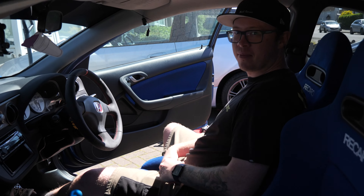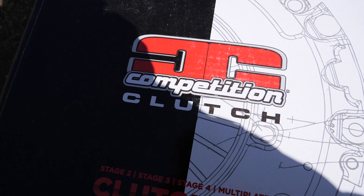Welcome back. So today this is Nurburgring prep — I'm scared of breaking down. What we're doing is trying to do a clutch on the driveway. We've got a good friend Scott, good friend Thomas, and we are going to attempt to do the clutch with axle stands and jacks. We're gonna get this bad boy out of here because the biting point is literally at the top of the clutch pedal and I do not like it. Rather than get stuck on the Nurburgring with all those fees for breaking down, I'd rather do what we possibly can to prevent it. This is our prep for the ring.